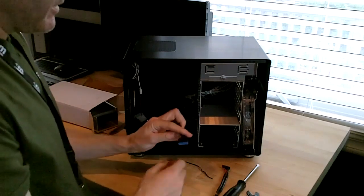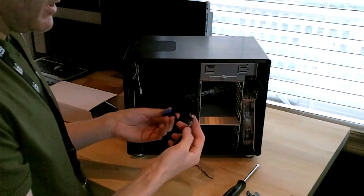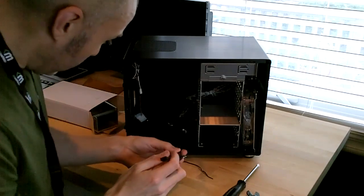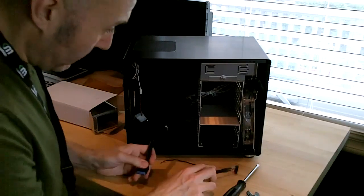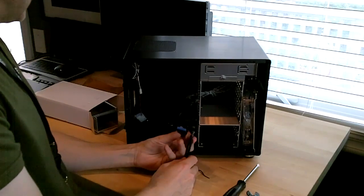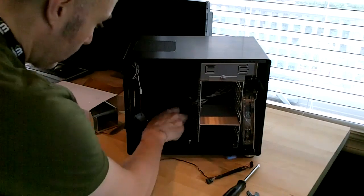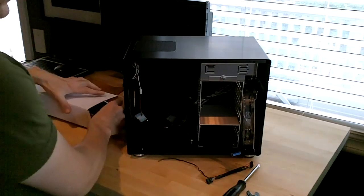Yes, they do actually have the USB motherboard header, which obviously if you're converting to USB 2, you plug into here, and then you can go into your motherboard USB 2. So that's kind of nice, unless you need to go to a motherboard that only has rear USB 3s, which I think is the case with my Gigabyte, so I think I might just have to make those front USB 2 connectors. Because, yes, it doesn't really look like it's an option in the front fan connector.